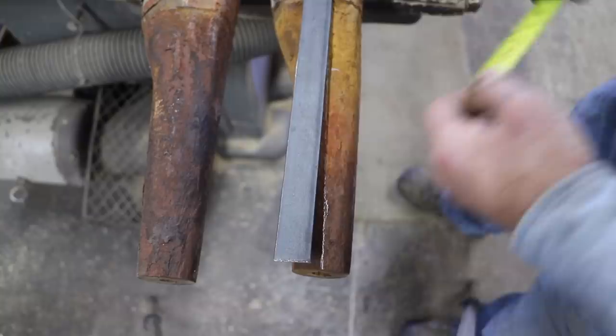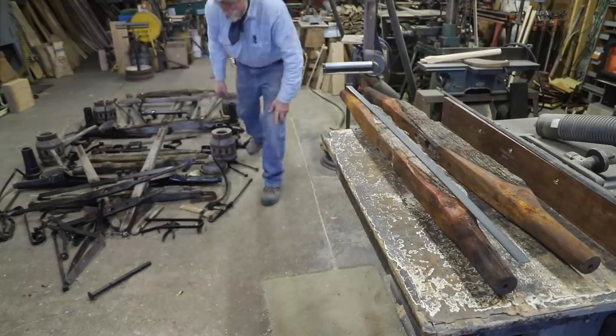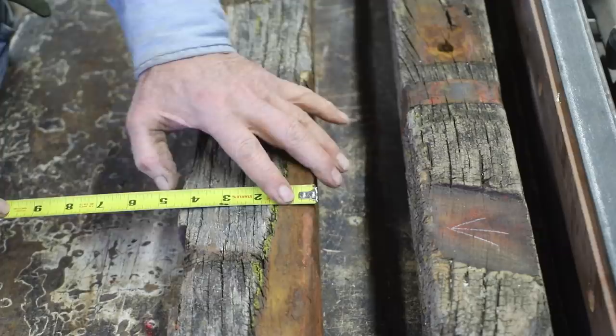So now, if you went back and watched that video regarding the axle gauge where I use it on a steel axle for a buggy or a carriage, you can see that the numbers are the same as they correlate to a wood axle. I use 1/8 of an inch toe in, or the gather, and it also comes out being 3/8 of an inch swing that brings the bottom spoke into plumb.